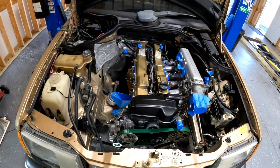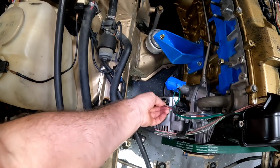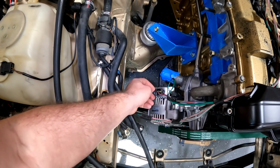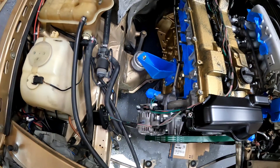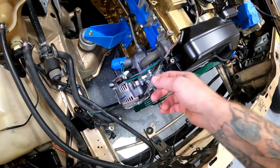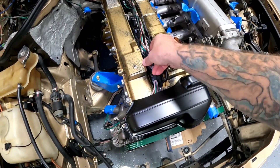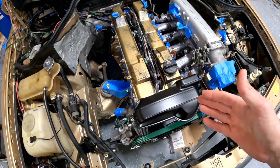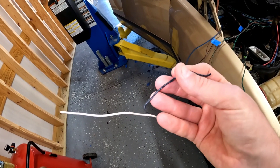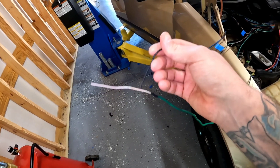Converting a GE to a GTE — you're going to need a MAF sensor, your three-wire alternator plug which is just a light that goes to the ECU telling it if it's working. The ECU still needs to see it. You have an S wire that goes to your battery positive terminal and an ignition wire that goes to your 12-volt ignition so the regulator knows the car is running. Crank sensor right here — feed those up, run them along the coil plugs and back. The wires that need to be shielded are shielded. Remember: if you're using shielded wire, it's useless if you don't actually ground it.